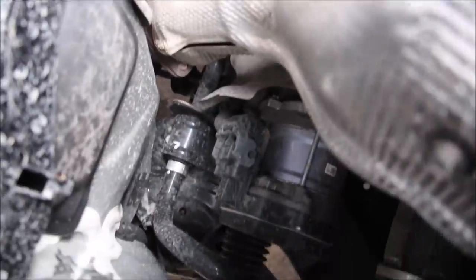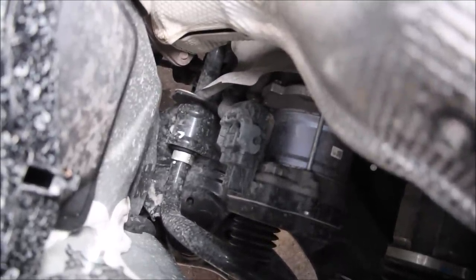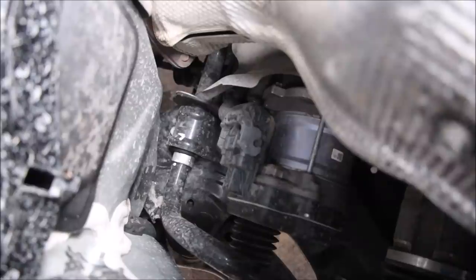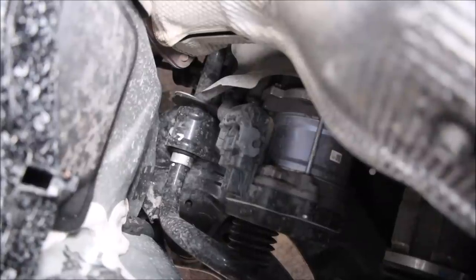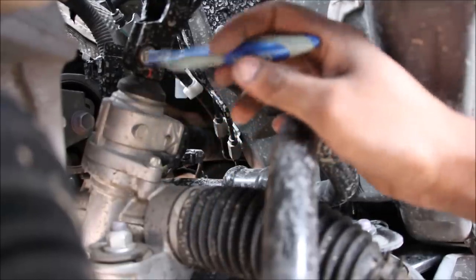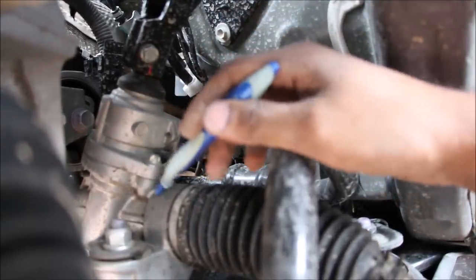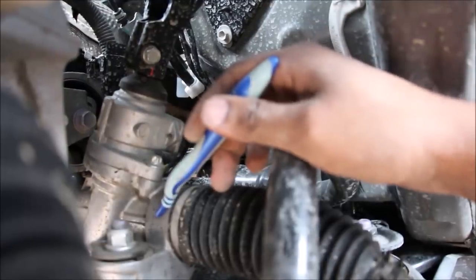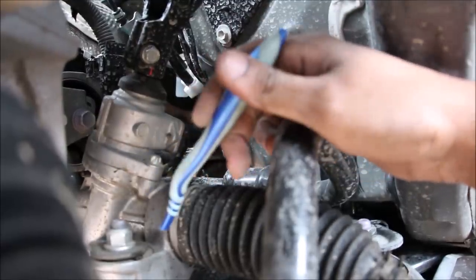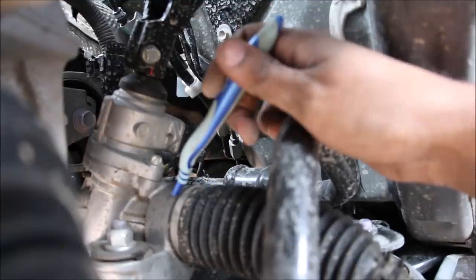Just underneath that exhaust manifold is the steering gear, and we've got the integrated electric motor down on the steering rack instead of out of the elements on the steering column like other Toyotas. Just past the CV axle you can see the power steering electric motor. If you follow the inner tie rod moved back we have the pinion gear where it comes off of the steering column and this universal joint. Unfortunately if you ever need to change the steering rack on this car you have to drop the subframe down, and Toyota doesn't actually sell the inner tie rods separately.